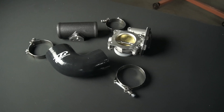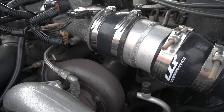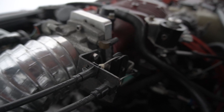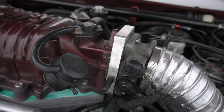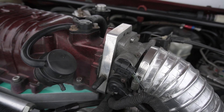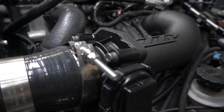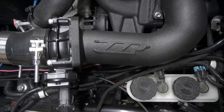To explain why so many manufacturers are using drive-by-wire these days: it's for more control directly from the manufacturer. In the past with cable throttle cars, if the car wanted to limit you, the only thing they could do was pull fuel and pull timing — and that can actually hurt an engine given the right circumstances.